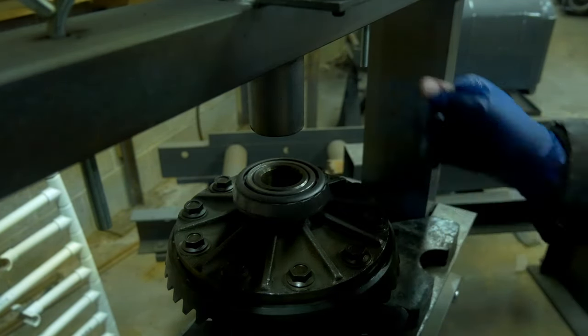After that, you put the drain plug in. These are torqued to 30 to 50 foot-pounds. Once again, do not break out the pipe wrench. This one, the fill plug, I'm just going to put in finger tight because I still have to put fluid in it, so that'll be my reminder for that.